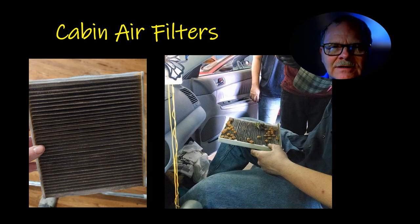Some of your Nissan Altimas will have the filter right in the center of the bulkhead. It's really odd because the filter is going to be a certain size, but it actually accordions together and comes out a hole that's only about half as big as the filter. When you get a new Nissan filter to replace it, you accordion it in there, stick it in, and it pops back out. The parts store will sell you two small filters where you stick one in, it drops down, you stick the other on top.